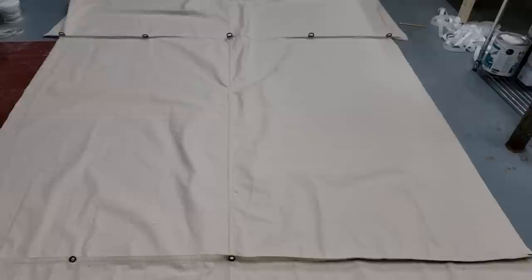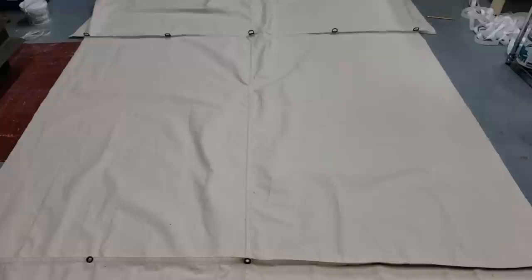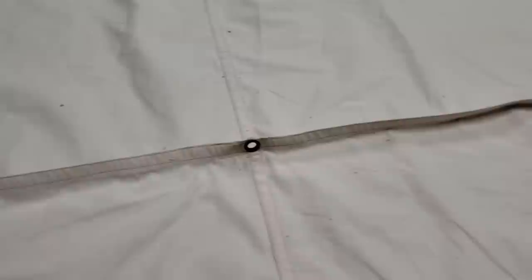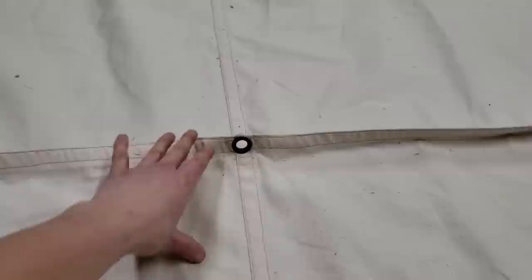Turned out really nicely. As you can see, I've got the grommets installed there all the way along. And what I did is I lined the grommets up with the D-rings there at the top where the front canopy meets the roof line, so they'll be symmetrical. So that's awesome. This one right here took a lot of time to punch through all those layers of fabric. I actually have been hand cutting the holes for the grommets just because it's been such a tough go to get through the canvas with the regular way you'd cut a grommet. So that's good to be done.